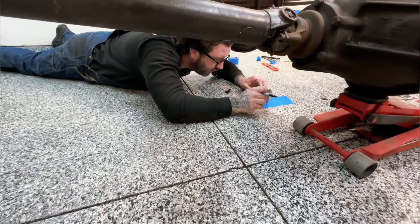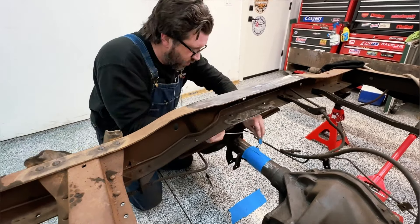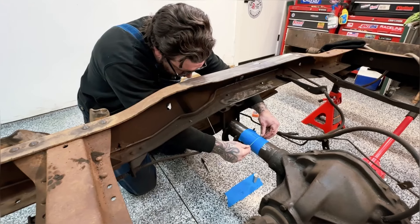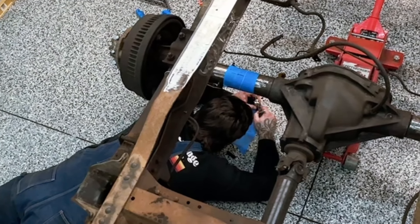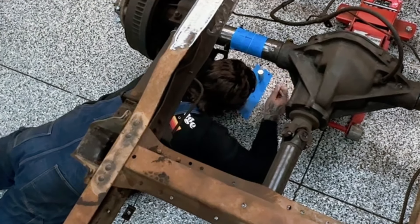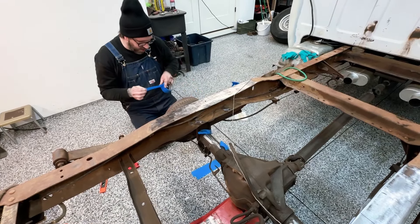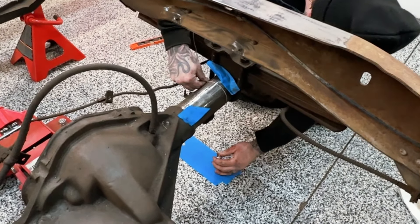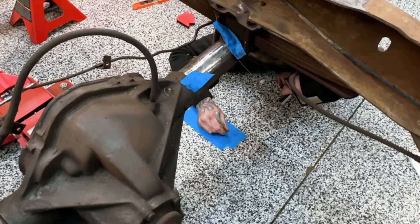I made a mark on the ground, which is actually perfectly underneath that plumb bob. One side done. This time I'm only going to do a dot, not going to do an X. These marks are the most important. One side done. So now we'll start marking the last ones. We'll go to where it just touches. I'm going to push down on it, put a little weight on it, take a little bit of a mark. Then I'm going to go ahead and sharpie that mark, and that lets me know that that axle is straight in that direction.